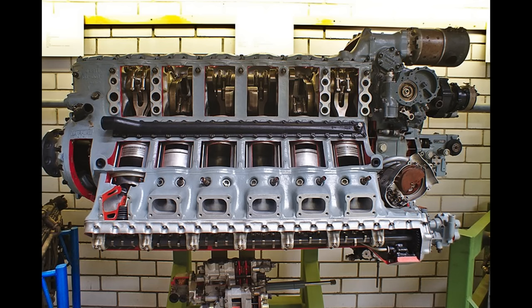To make up for this, they combined it with several power-adding features. First, we have the supercharger itself. It's a two-stage unit, which means that it has one larger supercharger impeller feeding a smaller impeller, which feeds the engine. It's essentially a supercharged supercharger on a supercharged engine.